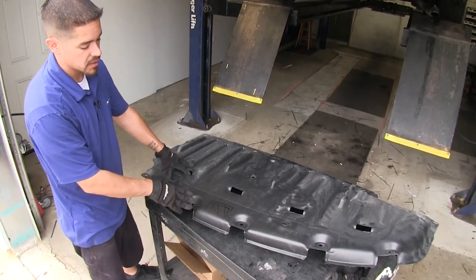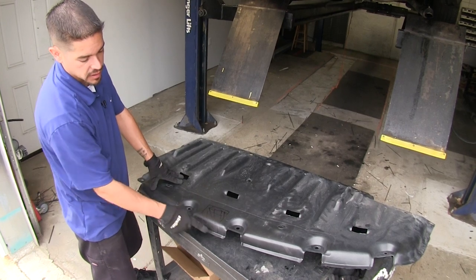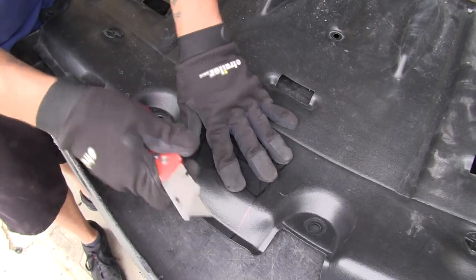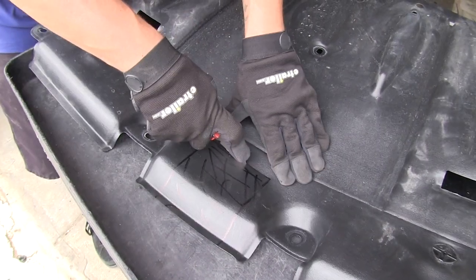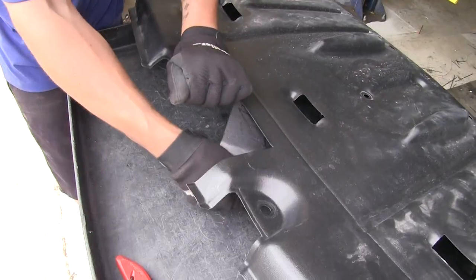In order to reinstall our appearance panel, we are going to have to trim it out. There is a diagram in the instructions, and I went ahead and measured and drew out the section that's going to be trimmed. This material is pretty flexible, so you should be able to just use a knife to cut it — just take your time and make sure you don't slip and cut any more than you need to.